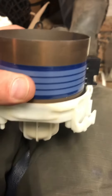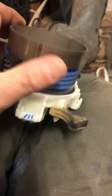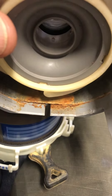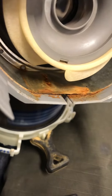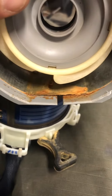So that's what happened — it leaked and I replaced it. So if you're wondering if your pump is leaking, or if you've identified it in that area, look for that same rust spot, because that's the bottom and that's where leaks would collect. Mine looked like this right away, so it had been leaking for some time. Hope that helps — leave comments or questions, happy to help. Thanks for checking out this video.